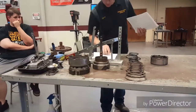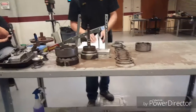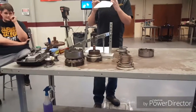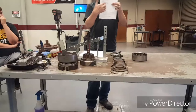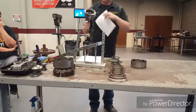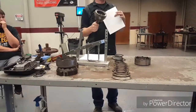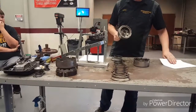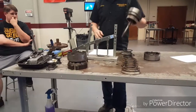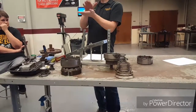I'm going to demonstrate that now. We're actually going to jump to the second line, then come back to my bench and do the first one. We have already reassembled the rear clutch — that's this one right here. There should be some movement when you wiggle it up and down. If there isn't, something's probably stuck where it shouldn't be. What we need to do is take some measurements to see if there's enough free play in the clutches.